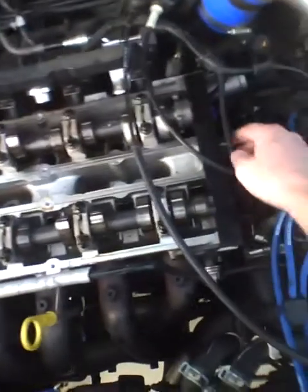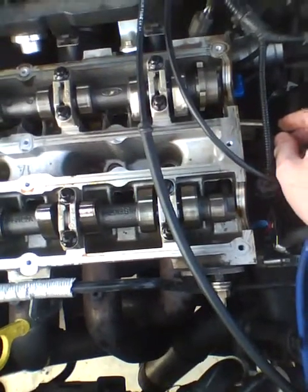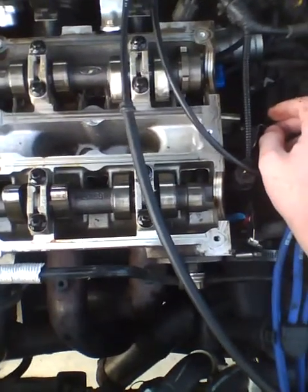Okay, now turn the crank. Okay, hang on, stop. I'm gonna remove the cam plate. Try and spin the crank until you hit up against the pin. It's already on the pin. It's on the pin? Okay. Now reverse it and go back just a little bit.